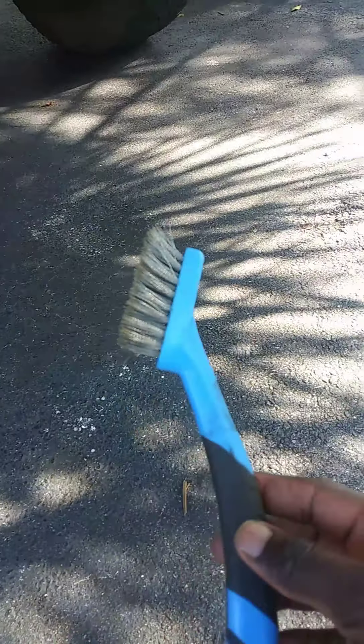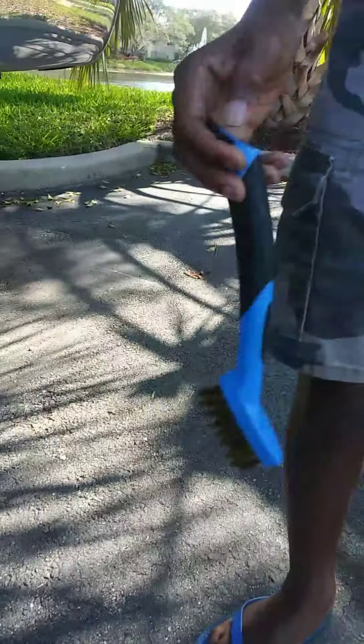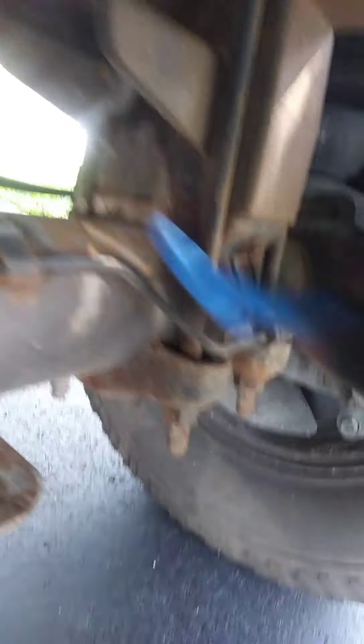When I say basic, I mean I'm going completely basic — I don't have a lot of tools right now. What's gonna happen is I might use a wire brush to start taking off some of the surface rust on the undercarriage. This is what we're gonna be using — wire brush. I got copper and steel. We're gonna get underneath and start surface rust cleaning, using the steel brush to take my time and go through it, and then we're gonna spray them.